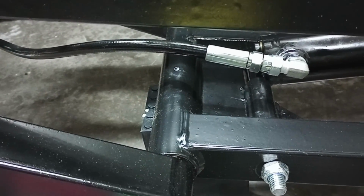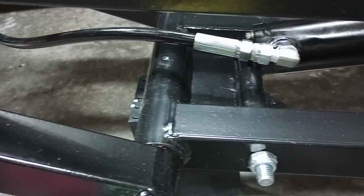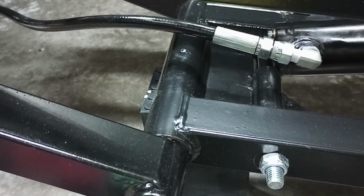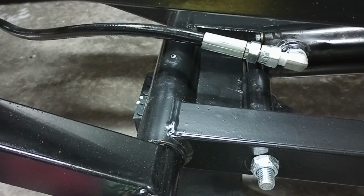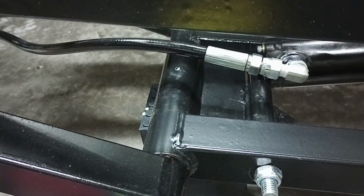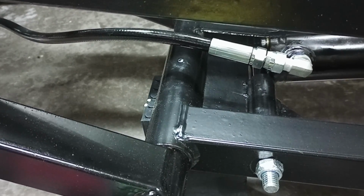One thing I want to note here is that you need to be cautious of how your hoses are placed. Now, in the beginning, they tell you to angle them up, maybe at like a 20 to 30 degree angle from the edge. One thing you're going to notice as you start to raise your quick jacks is that the angle of this hose starts to go down to this cross member or the flat area. You can see it's got kind of a white dot. When you raise them up, be cautious, keep an eye on your hoses. One of my hoses was not angled enough and it started to contact that cross member and started to put pressure on that fitting. So I readjusted that, re-bled it. Everything's fine, but if you didn't know or weren't cautious, it may spring a leak later on. Keep an eye on the contact, readjust as needed.